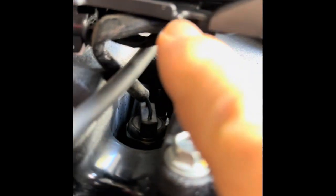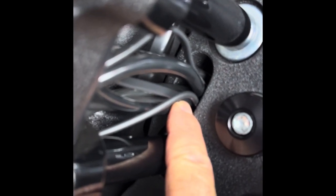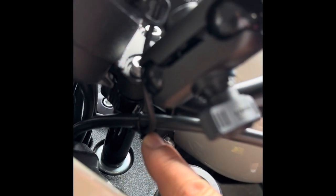There's a little wire organizer holder here. I ran it along there and zip tied it here on a cable. There's my wire, and I just left it loose until getting forward with all the other wires above the motor. I attached it with a zip tie to this cable and ran it up through that hole with occasional zip ties, and then another zip tie on the clutch cable right here. Here's the wire up here.